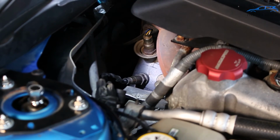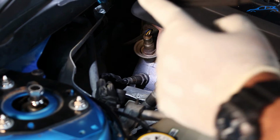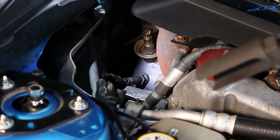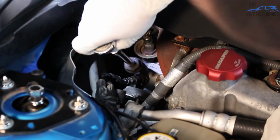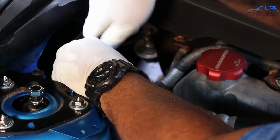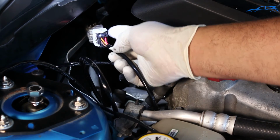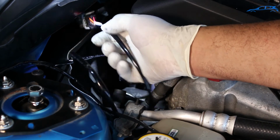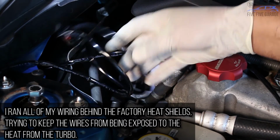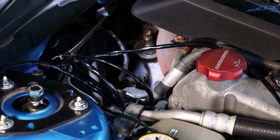And for those who don't know, this is an O2 sensor socket. It has a cutout so you can slide over the top, over the wire, and be able to tighten things down. Once you've got that snapped into place, the O2 sensor is installed and is ready for the interior line to be done, but we have one more sensor to hook up while we're in the hood.